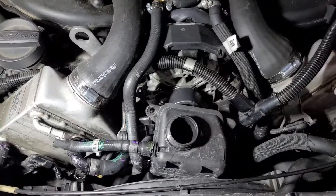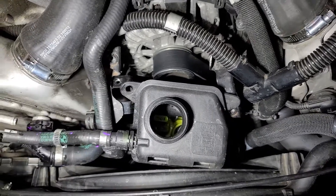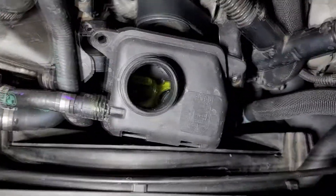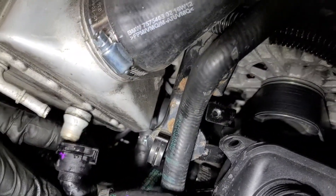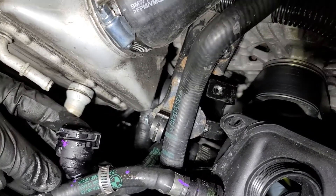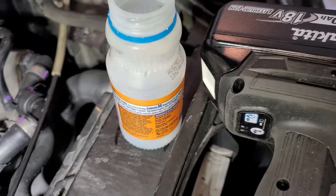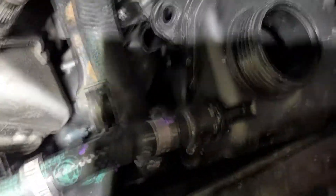I've tried to do this repair without taking the intercooler coolant tank out, but I'm not going to fight everything. What I do is drain this out by taking this hose off over here — when you aim that hose down you get the coolant that comes out of the bottom. Get out as much as you can — I use my daughter's Sunny D bottle. Then there's one more BMW clip on the very bottom of this reservoir.